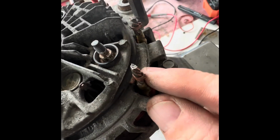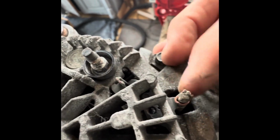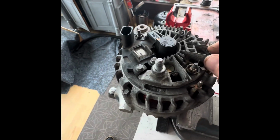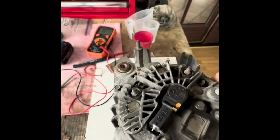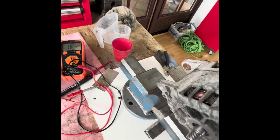Now I've put these here, look, and the way I've clamped those back up tight there, that's good. So then what we're going to do is run some solder on there, and those connections are all good. And you can just check that they all work, which I have. I've checked there's all continuity there, so that's all good. So basically we've done it. So the last thing to do then is take that. Well, let's just leave it like that on there.